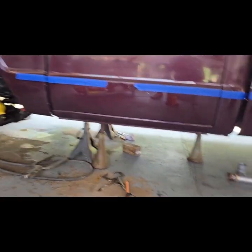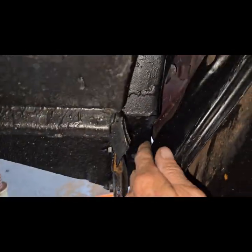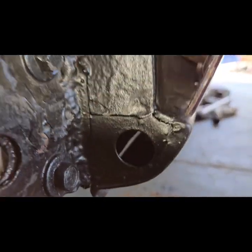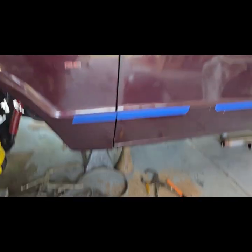I jacked the body up and got the body line right. I got a better gap here, and I can take even more gap out by jacking it further. The rocker that I sealed up — I welded the plates back on it — that's what's hitting the fender. I cut a little gap out of it and now I've got a pretty good fit.